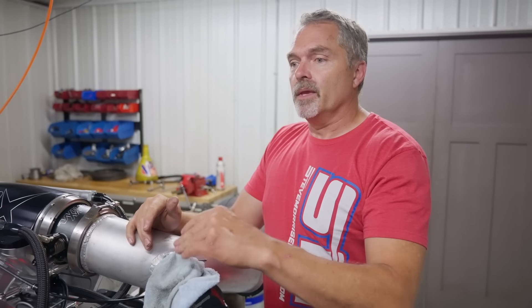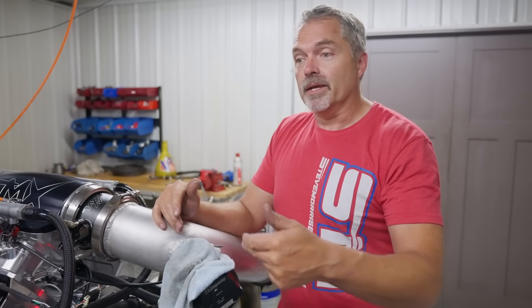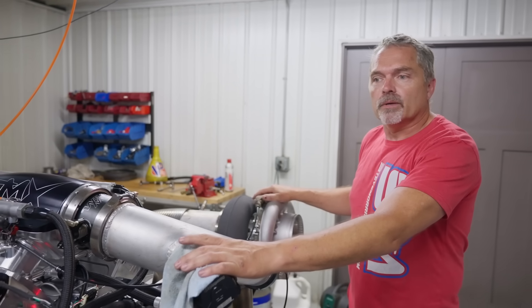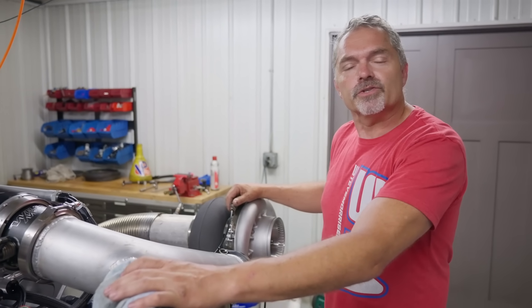So that's why we're going to close it. And so now I'm really curious to see if I end up putting 10 PSI dome pressure here, will it make 10 PSI boost pressure? Theoretically, I think it may. Even it would be spinning the blower faster to do it, which in a short term application like this, it's not that big a deal. But anyways, just trying stuff.